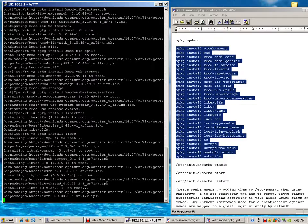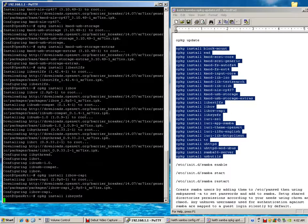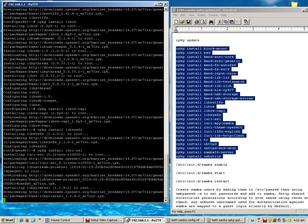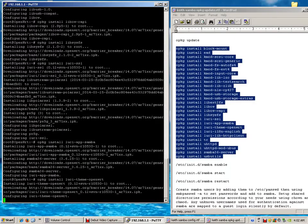What I'm using is flash drives, and it's got to be a good name brand flash drive. I had some off-market flash drives. You can use all kinds of different formats, FAT32, NTFS, all kinds. But OpenWRT recommends you use ext4, ext2, ext3, for the main reason that it's less hassle. So I said, okay, but a cheap flash drive, I couldn't format it to ext4 or ext3 or ext2. Couldn't do none of them. It came with FAT32, and that's what I had to put back on it just to get it to work.